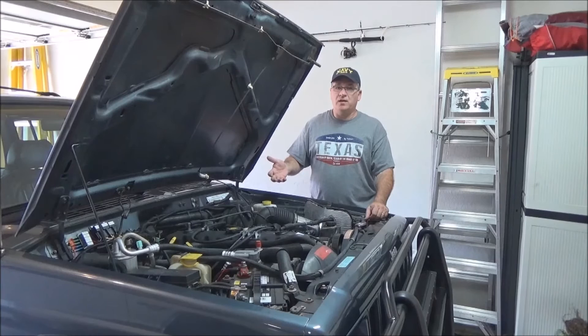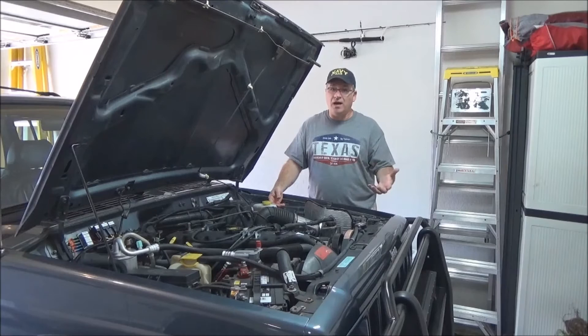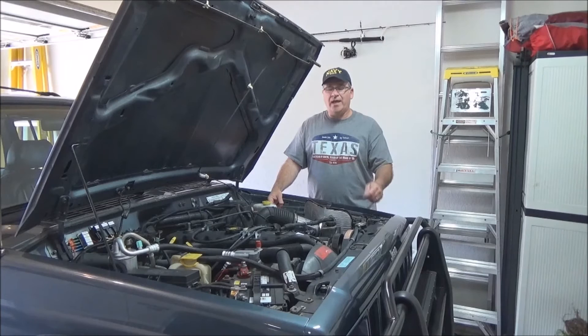If you're going to keep the disc itself, mark it — you want to put it back on the same side. Really, by the time you spend about 15 bucks at the junkyard for the disc and then take it in and have it turned, you're at the cost of a new one. So just toss that and get a new one at the auto parts store. Also don't forget to unload the pads — they usually charge you about five bucks a side for pads, and you sure as hell don't want to reuse them. Toss those too.